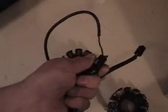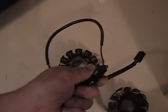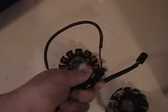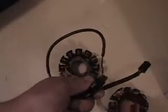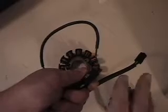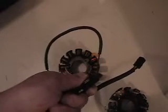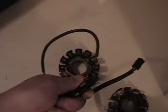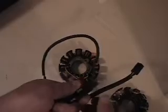That bypasses your entire wiring harness, because the wiring harness is notorious for shorting out and going bad on these triple cats and even the twin cats. Your key goes directly to your stator — key works normal, works fine. Off is off, on is on. What that does for you is bypass that entire wiring harness. We've done that on all our cats, and I know lots of people have had to do it on theirs also because of internal shorting issues. It doesn't matter which stator you have.